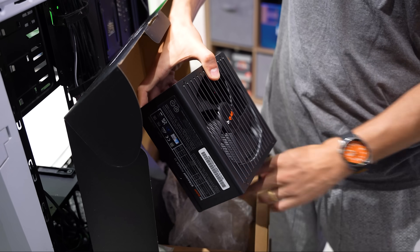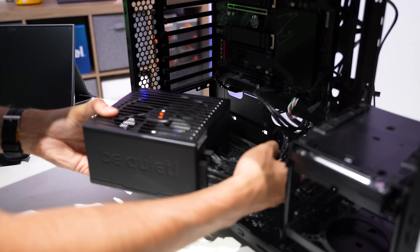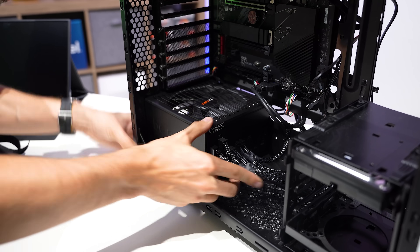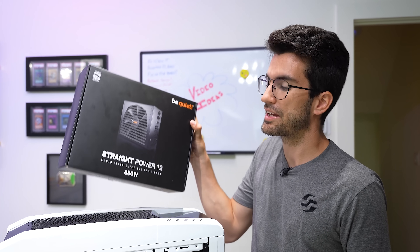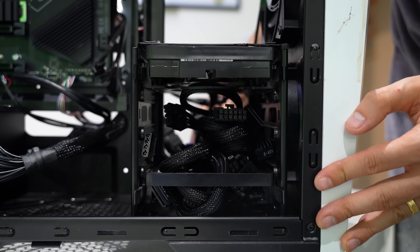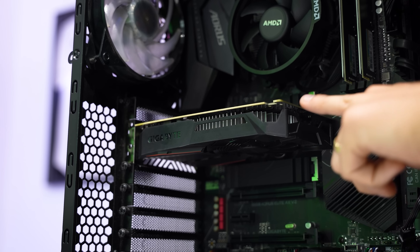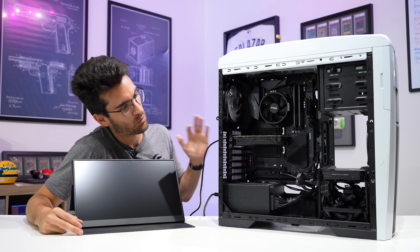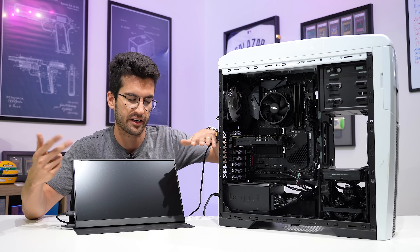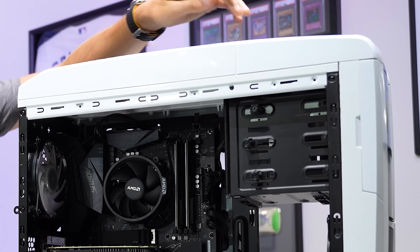Look at this beauty. It also comes equipped with a super quiet fan, so even when this thing is spinning you probably won't notice. And we only have to connect the cables we need. I want to thank Be Quiet for being a continued product sponsor of our Fix or Flop playlist. You can learn more about the Straight Power 12 by clicking the sponsor link below. I'm going to shove these extra unused cables below his hard drive, just so he has them in case he wants to expand things later. The last component to tackle is this graphics card — with this, we don't have supplemental power. Here's hoping that what we've done works now that everything's back together. We didn't address the hard disk drive. I did confirm that it was receiving power — you can just touch it and feel the vibrating platters inside, so I think that's okay.